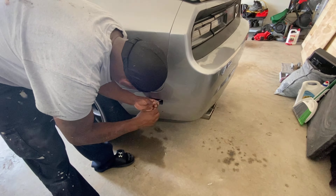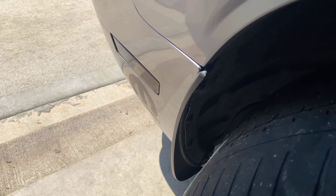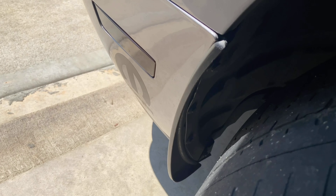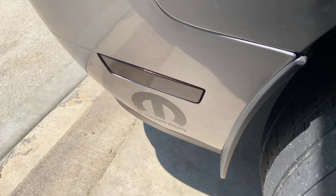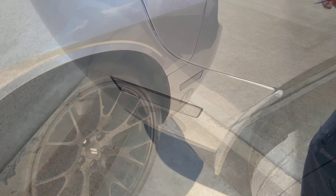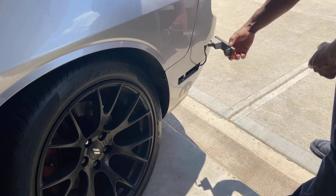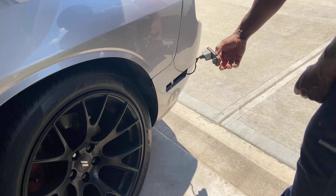So the front marker light is a little more complicated. You can go two ways — on this side you're going to have to remove this because you got to take the cold air intake and all that out from under the hood to get to it. Or you can do like I'm probably going to do and just stick a screwdriver in there and pop it out — it might break the tab. I'm about to pop the tab with this little flat head screwdriver. Didn't even break. So it's easy to do instead of taking all this off and going under the hood trying to reach it.